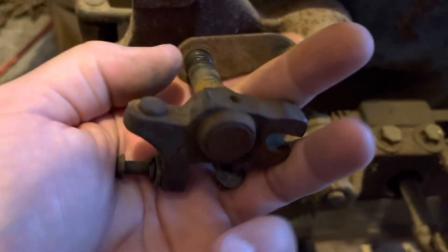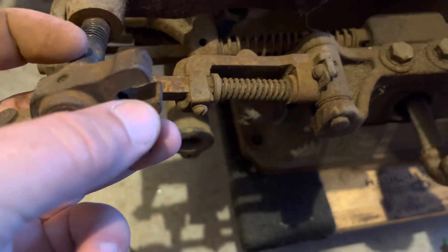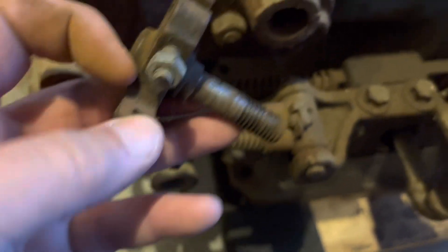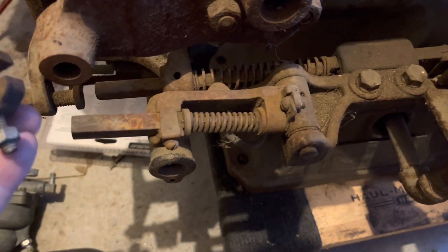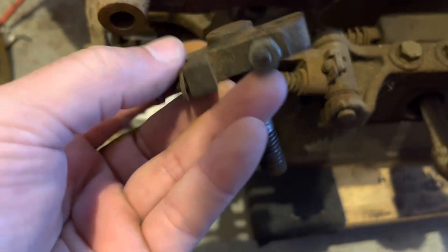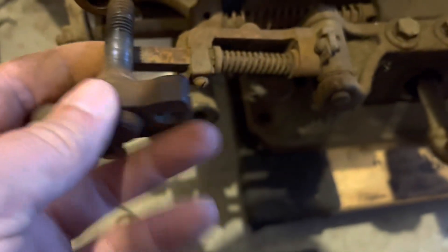The problem here is that this whole thing is, for lack of a better term, backwards — and it came right off, so that's good. This thing should be in here with the mag on the right side and not the left. This screw here is supposed to come in from the other side, and there's supposed to be a little piece of metal — I'm going to call it a striker plate — that this metal would hit to trip it. That striker plate is missing, so we may have to borrow one from a mag on another engine I've got sitting around. The screw should be on that side with the striker plate in place.